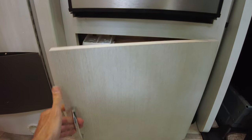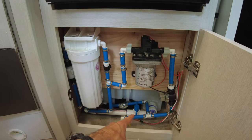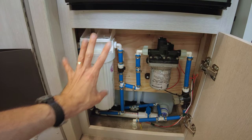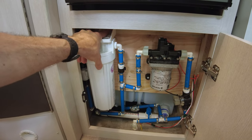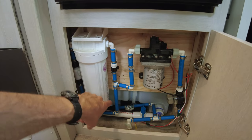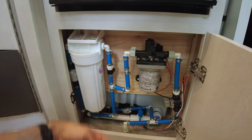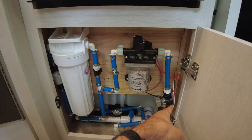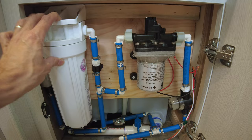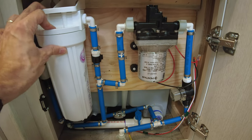Underneath the fridge is this access door, and this gives you access to a water filter, which is a really nice touch. It's got a 20-gallon freshwater tank, water pump, and this water filter built right in. One thing I didn't like is that they didn't mount it very well at all. It wasn't screwed in very well at the top, so it was whacking the plywood behind it as we went down the road and rattling a lot. So I secured that at the top and put a piece of felt behind it so that it doesn't make noise. This plywood was also only anchored at the top and flexing a lot, so I put a little L bracket down on the right to secure it. It was easy to fix, but I shouldn't have to fix that — that should have been done right at the factory.